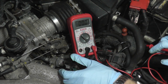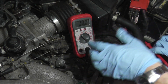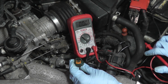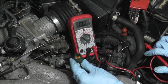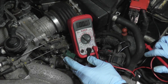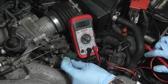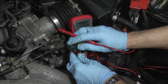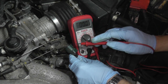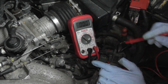If the wires look fine, you'll need to track down the fuse — there is a 10 amp fuse for this vehicle that makes this work, and that's most likely your problem. Very rarely it could be something with the ECM, but check the fuse first. If anyone out there has a Nissan, feel free to send me a message and I can tell you exactly which fuse to look for. Most of the time it's either the fuse or the wires are no longer in good shape. Once you verify you're getting power to the harness connector, you need to check the sensor itself.